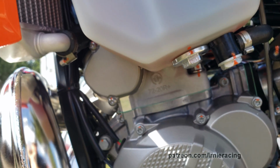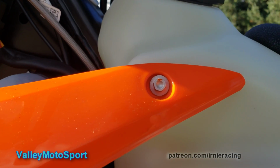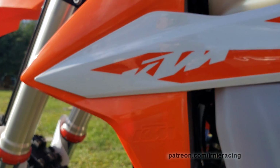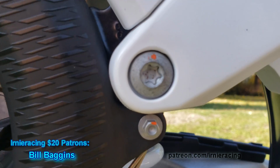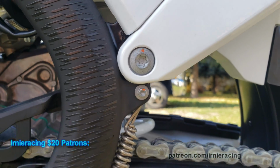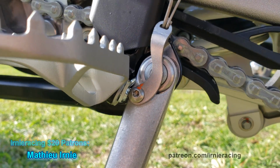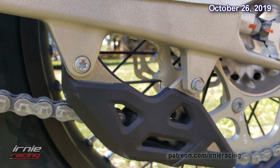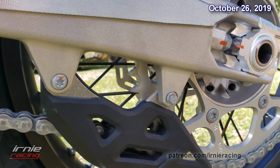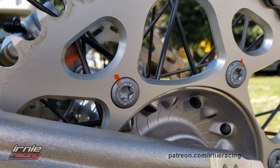Before I get the bike dirty, I am pretty much marking every bolt that I see. And then I can recheck as time goes on to make sure nothing is loosening up. Now the strategy I do is pretty much 12 o'clock. And in certain scenarios you revert to a different strategy, to whatever you can see. So the next time when you go to mark the bolt, if you can't see 12 o'clock, then you know, okay, the rear sprocket's always to the outside.